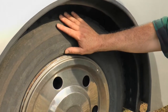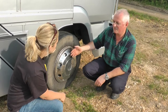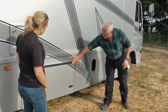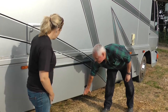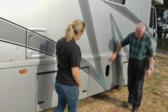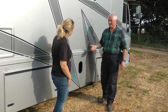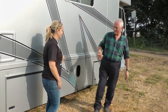Other things — although this one is fitted with a cover — we should also be checking the tightness of the wheel nuts. Not everything needs to be checked every single time, but certainly things we should be checking often. What about the side of the horsebox — is there anything to check here? Under-chassis storage areas are fabulous for keeping kit in, but we need to make sure they are properly secured in place — just give them a check to make sure the locks are actually holding them in place. And another very important thing: this one is fitted with a fuel tank on the off side. Make sure there is a cap fitted to the tank and that it's fuel-tight. You don't want diesel leaking out as you're going around corners and splashing onto the road surface — motorcyclists hate diesel on road surfaces.